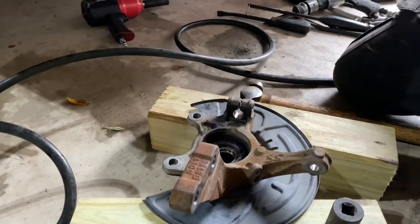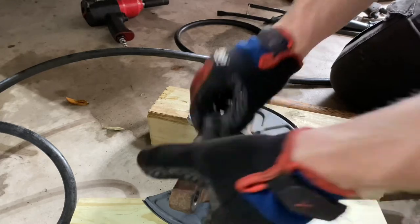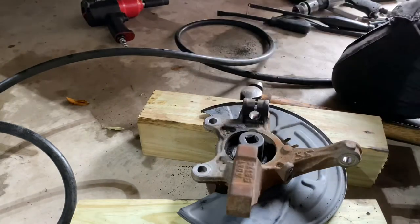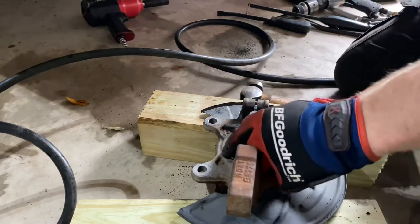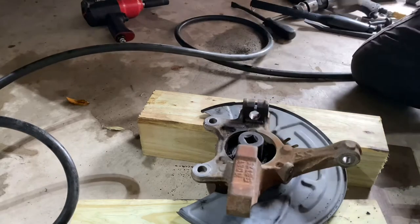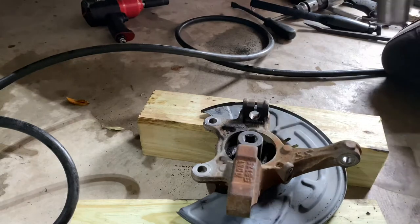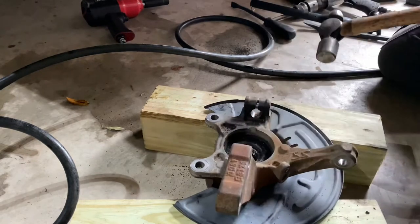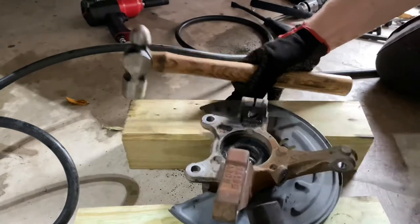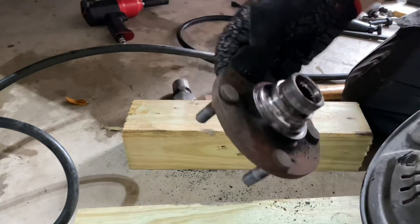All right. Here I've just got two pieces of four-by-four and an appropriate socket that fits perfectly on the back of this hub. We're trying to press the hub out so that we can take out the snap ring on the front and press out the bearing. You can use a slide hammer and a hub puller to pull this off when it's still on the car — this is just another easy way that just about anybody can do. Find a socket size that fits just on the hub and give it quite a few hard whacks with the hammer. As you can see, the hub has now released.